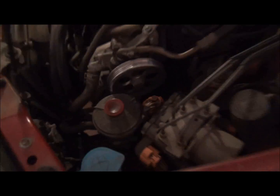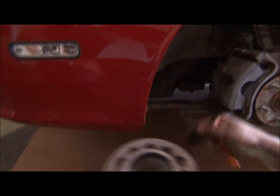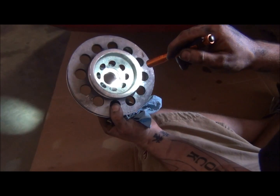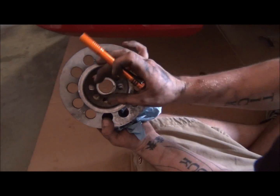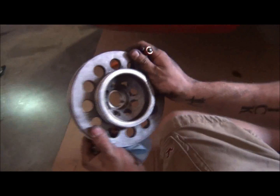And then since we had our crank bolt loose, I spun that out. So we got this guy out, and this is what I was talking about, how this one doesn't have the little open slot in the socket in here, because it's aftermarket. So that's why we had to do it the way we did. But if you had the other one, you could put the tool in there and then break it loose. So this one was a little bit stuck. Just kind of work it back and forth, maybe spray some penetrating oil in there and break it loose.